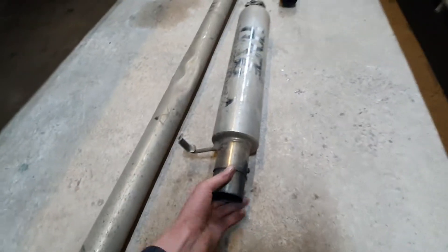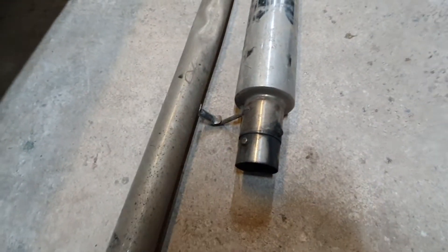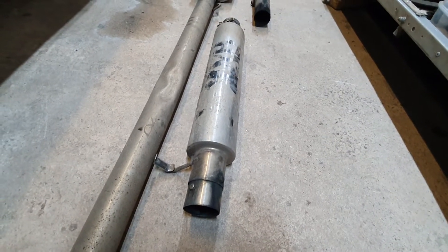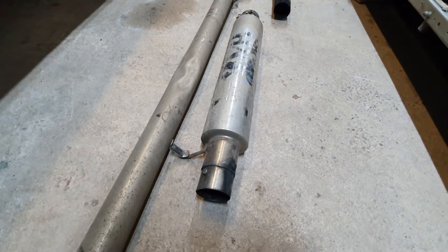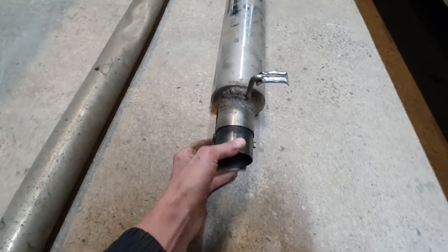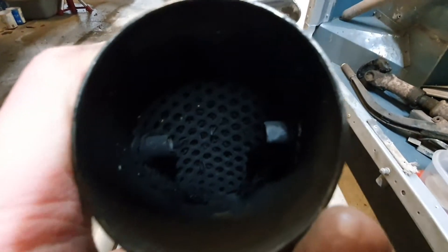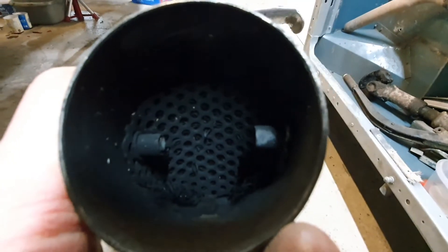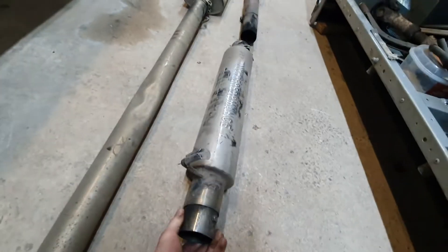This is a removable piece I made — you can see the two bolts there holding the internals together. You just undo that bolt and you can take it out so you've got full straight-through performance and noise, and it's incredibly noisy. When you're revving it hard, it's just noisy — it's not offensive. But when you're down at around 2,000–2,500 RPM, the resonance is absurd, it's really quite painful. So I had to make these as a quick fix, and I've been driving around with that quick fix for years. I've put some perforated pipe in there, bent over so it blocks up the tube, and behind it is some stainless steel kitchen scourers. It seems not to hurt performance too much, which is incredible really.